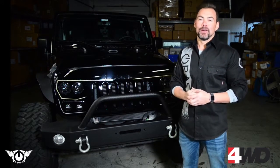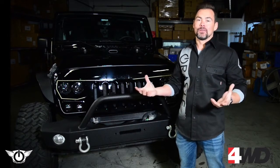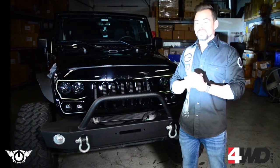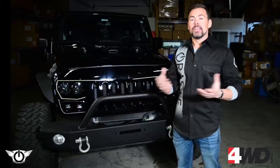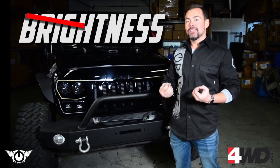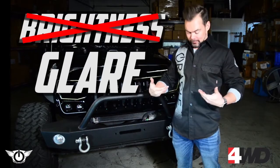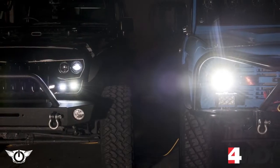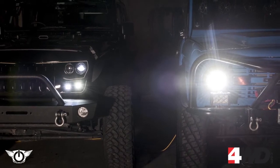We've tested several different Jeep Wrangler aftermarket headlights and there were some out there that caused an enormous amount of glare — and honestly they're just not even safe for street use at all. So yes, the Vector Grille is bright and has much more light output than the factory headlights, but brightness isn't what blinds oncoming traffic. Glare does. While the lights on the right may appear to be brighter, that's not actually the case — it's the glare that makes them appear more bright.